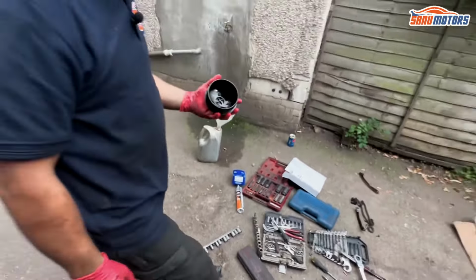So a little run, so the oil level is settled, is fine. But in the morning that will be fully cured, and if there is oil pressure, that won't push through that silicone barrier. Well, while it's tacky wet, if there is oil pressure, that will blow it up. Same with the coolant. If you seal the water pump with it, you have to wait until it dries off. Otherwise, the water pressure will blow the silicone out.